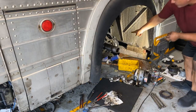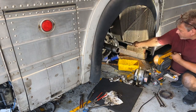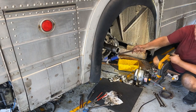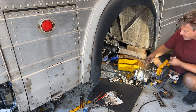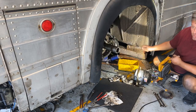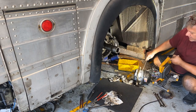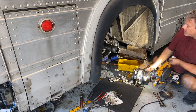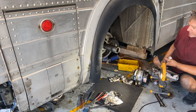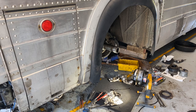If you look right there, there's just one brake — just a 30 can, a single air diaphragm brake chamber. It doesn't have a spring brake. They got around that by adding one in the back which is just the spring, so it's basically split in half — half here and half back there. We're going to cut this mount off, move it over about two inches, and then we can add a 30/30 spring brake can here and eliminate that one in the back that was added later. Spring brakes weren't invented when this bus came out — they just had that driveshaft brake, which has been disconnected and we've now eliminated it completely.